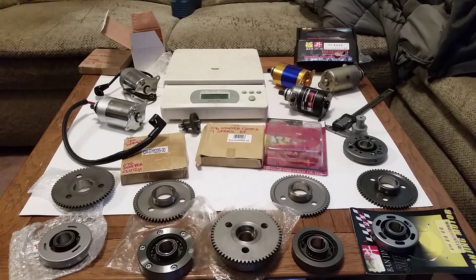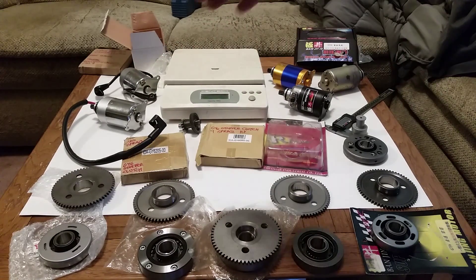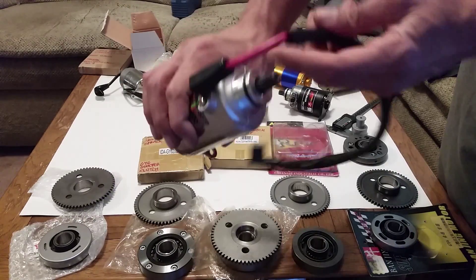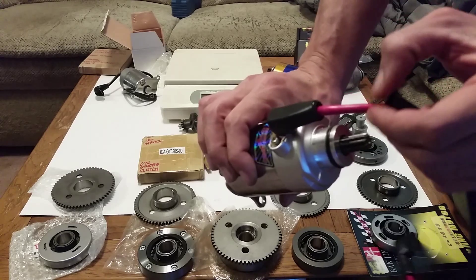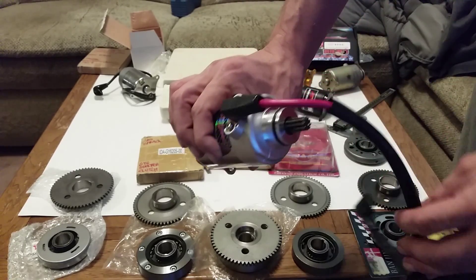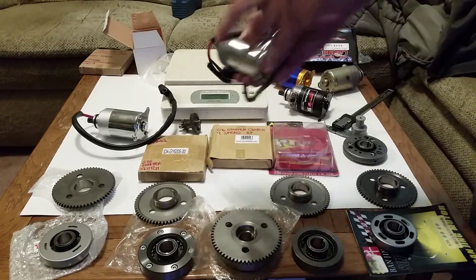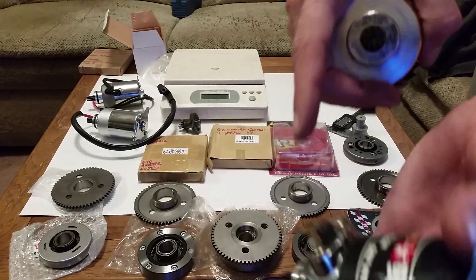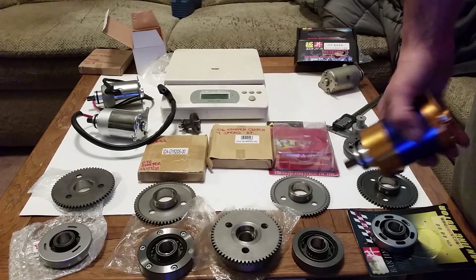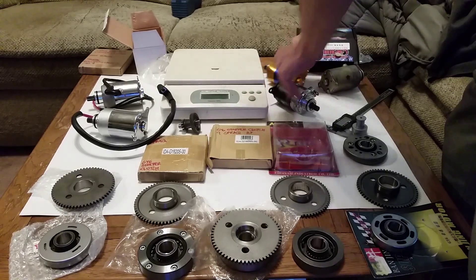One more thing: when you upgrade to a high-performance or high-torque starter, make absolutely sure you use heavy gauge wire. Tata automatically includes a really nice thick wire — probably somewhere between six and ten gauge. The copycat one has thinner wire, probably 10 to 12 gauge. Banjing doesn't supply wire at all, and neither does the lightweight starter. That extra wire weight may explain why some starters weighed heavier than expected.